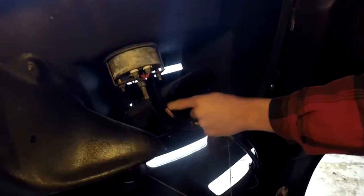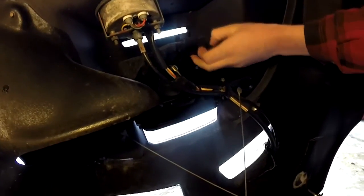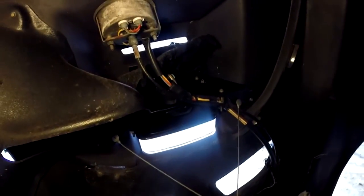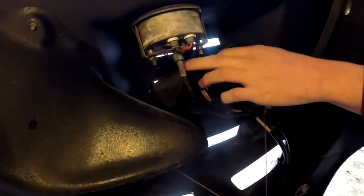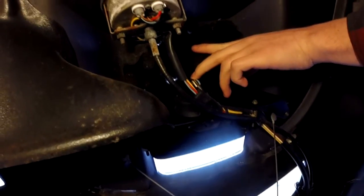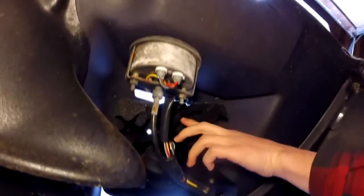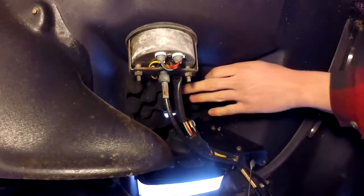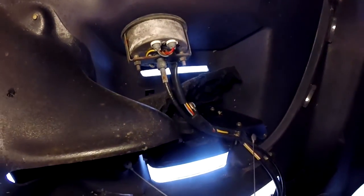I don't know which one, since it's such an old snowmobile. This is the headlight, and I want to wire it into the headlights. I know when you turn the high beams on, you have this little thing right here on the console which lights up, and you have this wire, which is the same as the wire that comes up to the console. So I'm thinking the white is usually ground, and I'm saying this is the high beams. If not, we can cut the brown wire, which I think is the low beams, too, but we can always attach it.